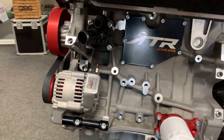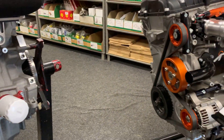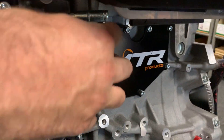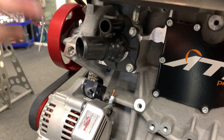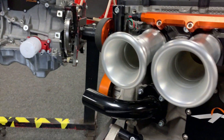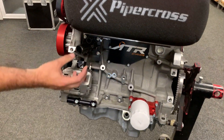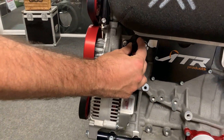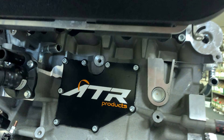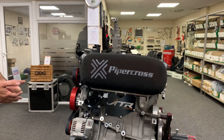There are options on the anodising. On this one we're using the standard thermostat and water elbow. We've also got a different pipe for different applications. The latest development we've done on the water system uses the standard Ford one — we're actually blocking that top one off with a bung, then using that pipe and routing it around to the back into the rear housing, or if you're in a car that's got a heater matrix, it would go into your heater circuit.